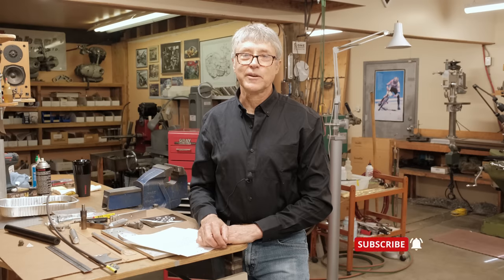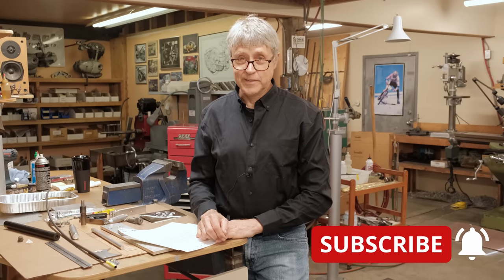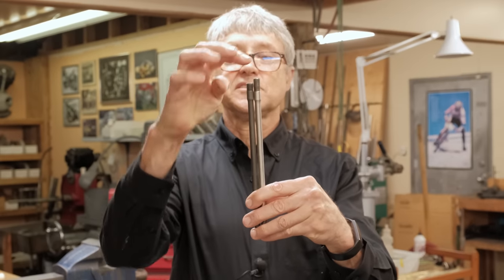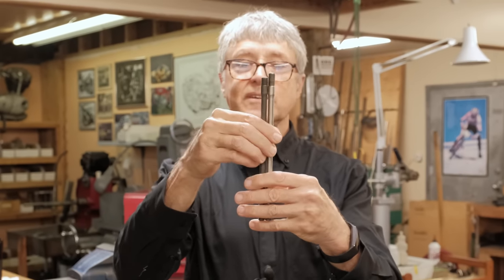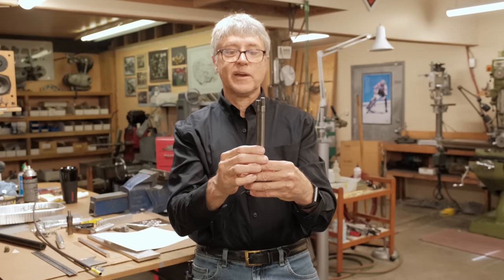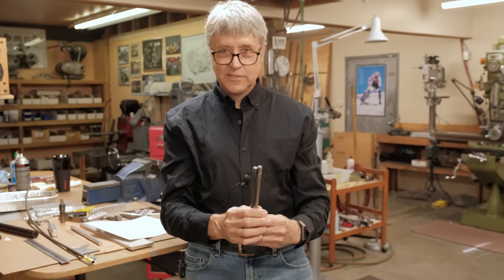because we are in the land of Aermacchi here, apparently. I'll show you what has happened in this last week here. I shortened some head studs. You can see this is the stock length. There's a few lengths actually, but for this motor, I had to shorten it because other things have been shortened, like the barrel. So I worked on getting the head nuts torqued down.